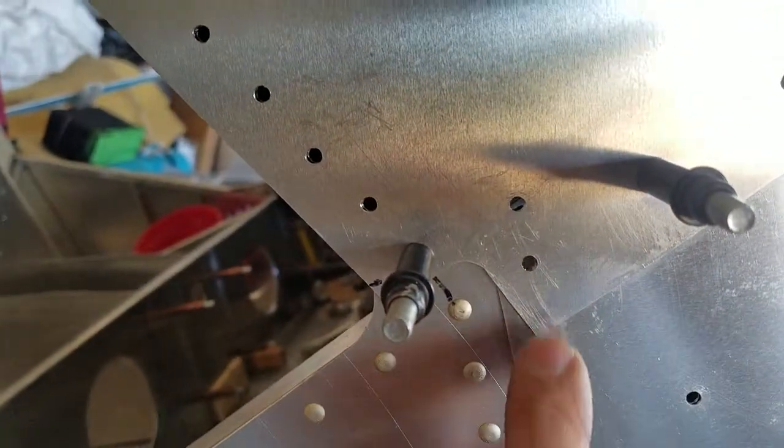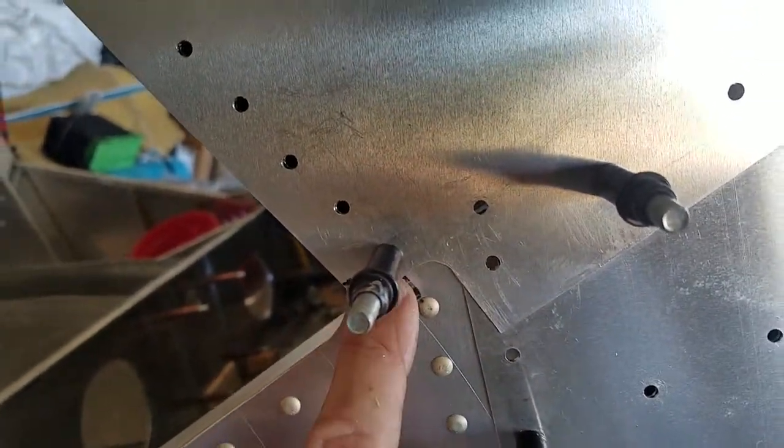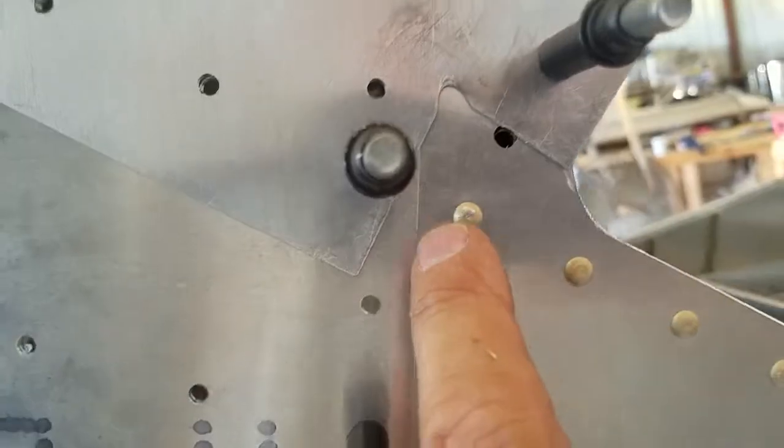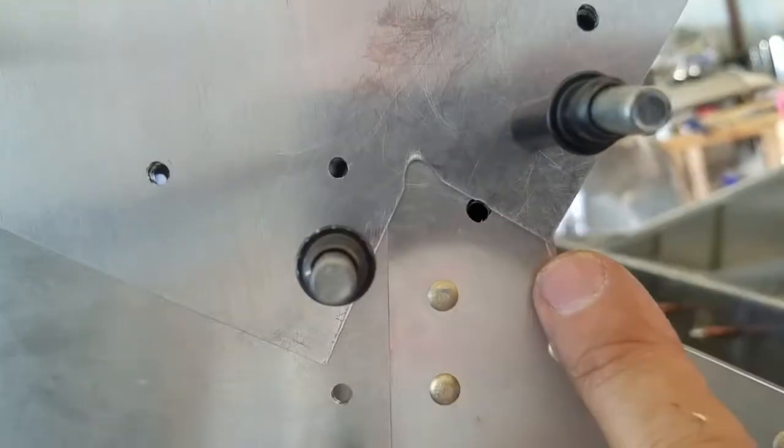This right here — this little edge — I'll show you. This is the factory edge. When you fit this, it has to tuck inside all that structure you can see over there. It has to tuck in over here, and this one wouldn't go down far enough, because when you put it in, there's a little buckle right here on the instrument panel. So I had to trim it — I put it out here — and I had to trim this a little right here. You can see I put a radius in it so it wouldn't split. And that was before I decided to bring this out.